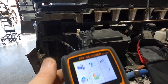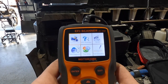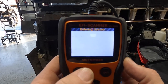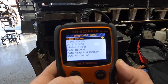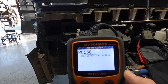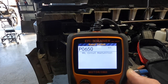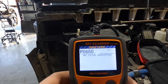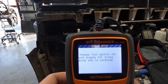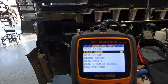The ECU is powered up. We'll go to Motor OBD2, enter — that is a Delphi system — hit that and we're entering it. We can read codes, and this is a very common one for the instrument cluster on the Zeus: MIL circuit malfunction. I find this all the time with the Zeus. You can clear that out, but it's guaranteed to come right back.